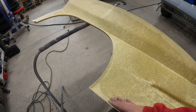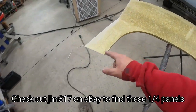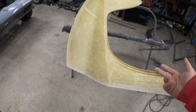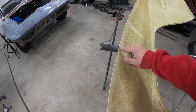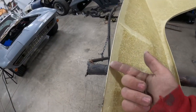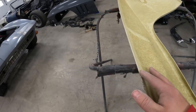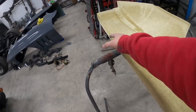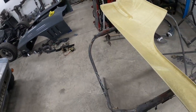Here's the underside of the quarter panel. There's a little raised area that runs through here which outlines where the splash shield should go, and then there's the same kind of shape that shows where the floor section bonds up to it. I assume on new old stock or original GM panels they did that to tell the guys where they had to grind or put their glue. There's also this little ridge here — I'm pretty sure it's either flashing from the mold or it's purpose-built to space the quarter panel off the bonding strip to ensure a minimum glue thickness. If you're having trouble getting your quarter panel to fit, this thickness may vary — it's a little taller back here than towards the front. My quarter is standing a little higher than the rear deck, so I'm going to scuff this whole area with 36 grit to help the quarter fit a little better, and clean up all the bonding areas since we're getting close to gluing.